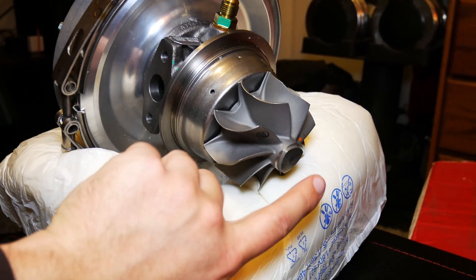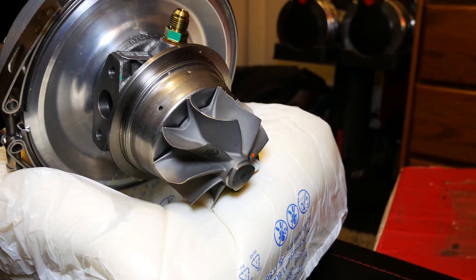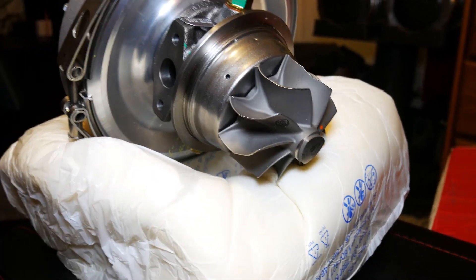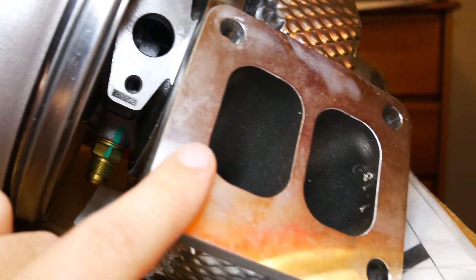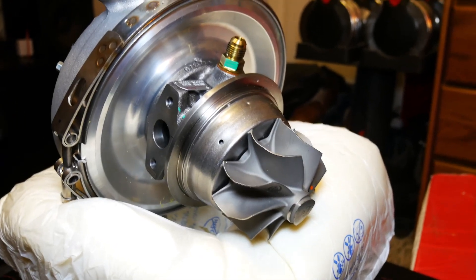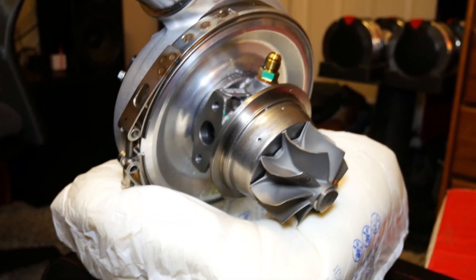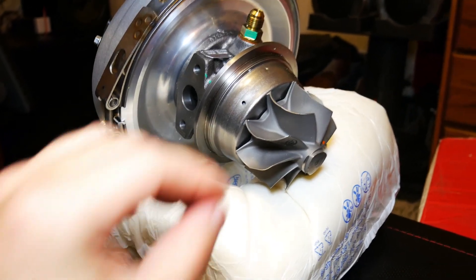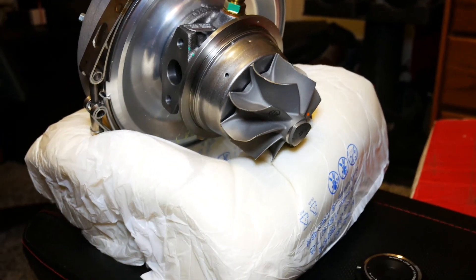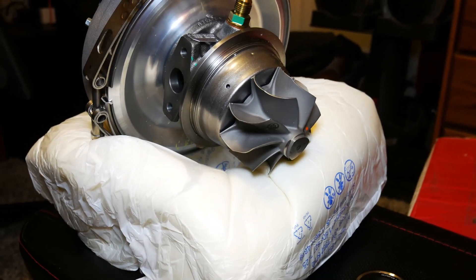This is their new technology rated to 1050 degrees Celsius - it can handle higher heat. The turbine housing that you'll see in this one - this is actually the turbine housing I'm going to put onto this turbo - I have a 1.28 T4 divided going onto this turbo. Those are designed to be much higher heat. This setup could be well into 40 pounds of boost. The EFRs you're pretty much ending at about 30 psi because the gamma-Ti wheel from them is very delicate and therefore can expand to a point of explosion.